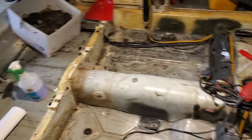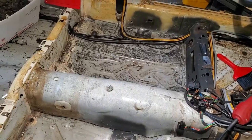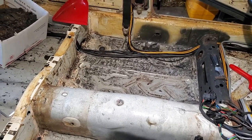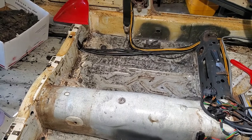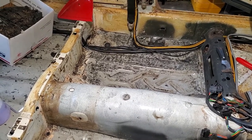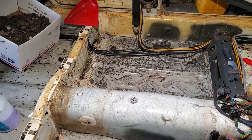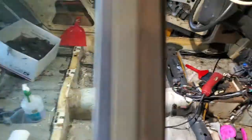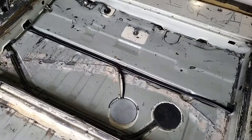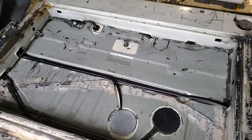When you take it up, you're left with that black tar-like glue residue. What I found is if you just take a little bit of mineral oil and wipe it on, let it sit for about five minutes, it'll wipe right off. These were almost completely black before I hit them with mineral oil, and you can see how nicely they cleaned up.